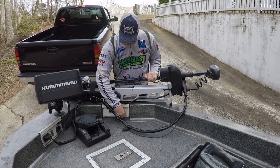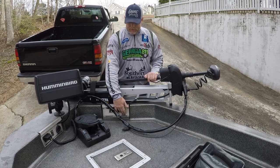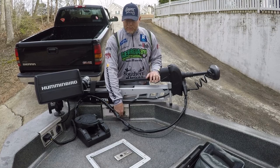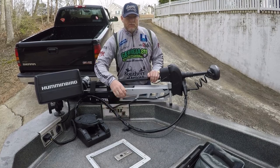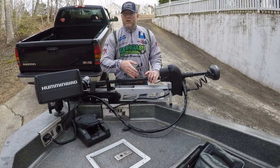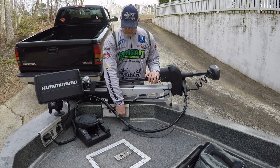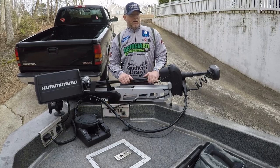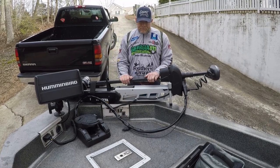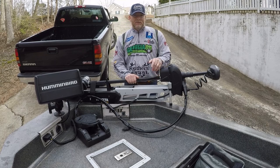This switch that I've got here underneath, if folks don't have this, tournament fishermen, I'm going to tell you something. We put this on the boat last year, and I've been very pleased with this automatic timer. You can set it at increments where you can either run it all the time, or set it at 1 minute on, 1 minute off, 3 minutes off, 1 minute on, or 7 minutes off, 1 minute on. This timer I've got directly here, so whenever we get our fish in a live well, I'm up here and able to control it directly how I want it set. So we'll go through the rest of the boat and show you the back of it.